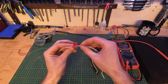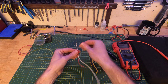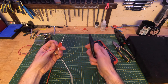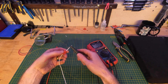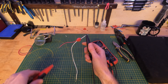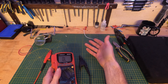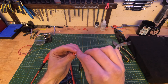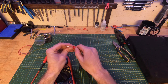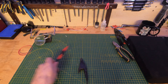Once you get that all jammed and flushed, you just lock it into place and you're done. You can do a tug test and test continuity with alligator clips — which it does have. One issue is you can see metal exposed in there, so water can get in. You can fix that by taping it well with electrical tape, and that's fine. If you don't want to do soldering, this is totally acceptable. Just go out, buy some T-taps, get the job done, and enjoy your lights.